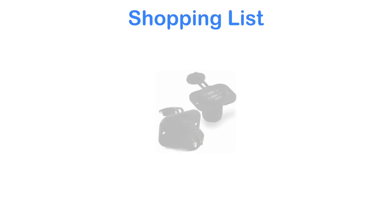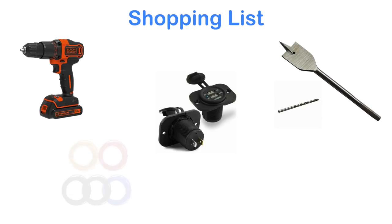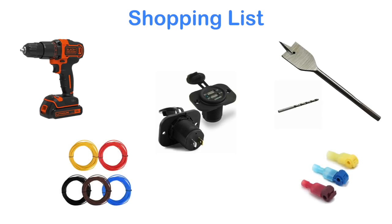To make this work, there are some items we're going to need to purchase. First, a USB socket that runs from 12 volts and has two USB outlets — designed to be mounted on a panel, so absolutely perfect for our needs. To fit it, we'll need a drill, a 28mm hole cutter, and a small pilot drill. To wire it up, we need some lengths of cable, some scotch locks, and some spade crimp connectors. A shopping list and all the kit I've used is in the description below.